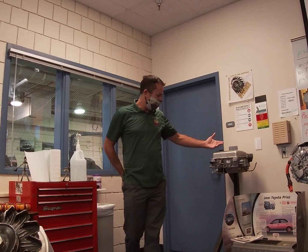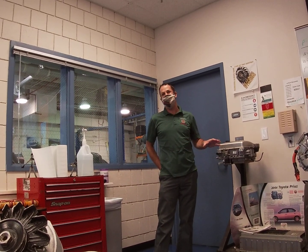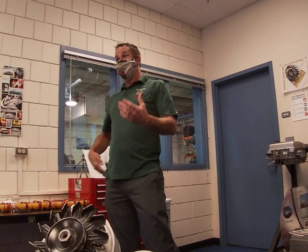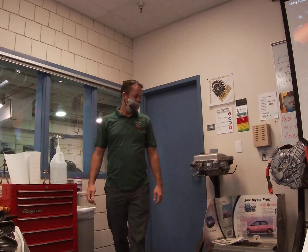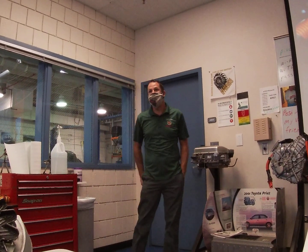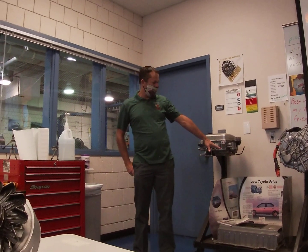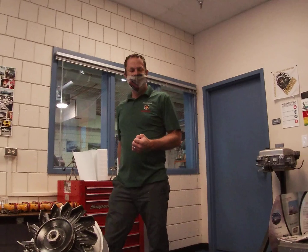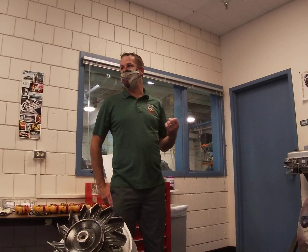This goes back to the Prius, which really paved the pathway in my opinion for the hybrid and electric vehicle of today. Before this era you just didn't see a hybrid on the road. When this vehicle was first launched I was working for Toyota Motor Sales, and it was pretty interesting to see these cars first hit Los Angeles in the late 90s — the testing, the concern of hey, can this car go fast enough down the highway? Can this car go in the mountains? I'll admit, I'm a skeptic too, and come to find out with the battery advancements of today, they do it — they get you where you need to be. We're dealing with a 273-volt battery, close to 300 on a lot of these, and we've got to be careful on how we isolate it.